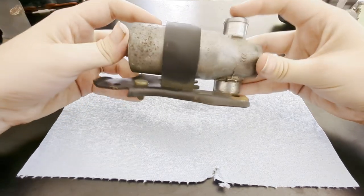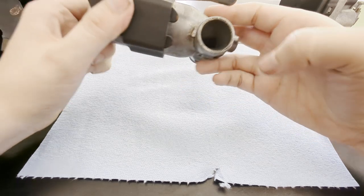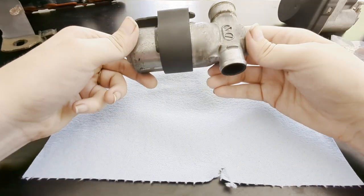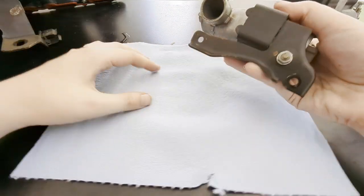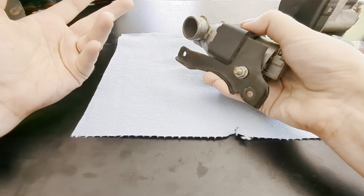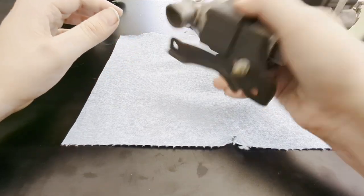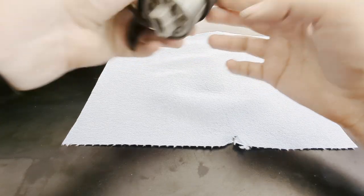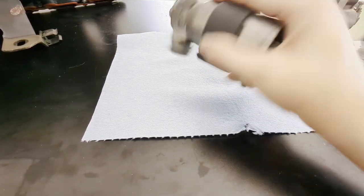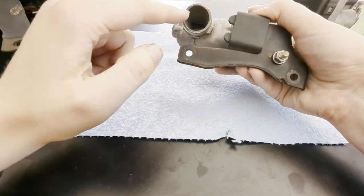This is what your air idle control valve is going to look like up close. There's actually a little valve in there that flaps open and closed. What happens is so much carbon ends up building up in these that that valve will usually get stuck. When you take this off, the way to test if yours is stuck is you want to rotate it — it should sound like a rattle can. When I turn mine, I can't hear anything; my valve is stuck. If I do it a little more forcefully to try to loosen it — there it goes. It's sticking, so we're going to go ahead and get this clean so that valve will open and close properly.